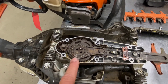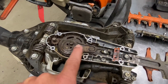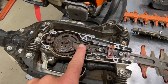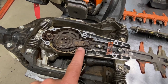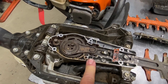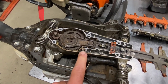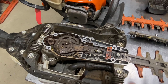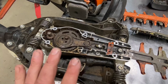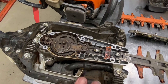If you do see a dry gear case, occasionally we'll see a broken connecting rod. There are two of these — one on top and one below that run the blades — and they tend to snap off at the end. A lot of it is abuse: hitting a piece of rebar, a really heavy stick, whatever it may be. If the blades aren't functioning properly or the gear case is making noise, pop the cover off and check the gear case, make sure everything's okay and it's greased properly.